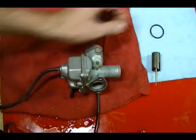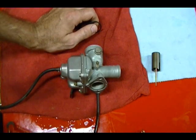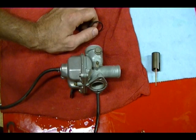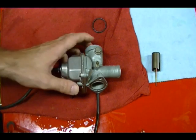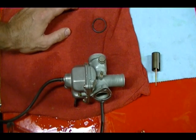The method I'm going to use is an ultrasonic cleaner. It's just water with a cleaning solution, and it uses ultrasonic waves to clean any gunk inside the carburetor. The advantage is that you don't have to deal with toxic chemicals, and you don't have to worry about any plastic or rubber pieces being ruined by strong chemicals.